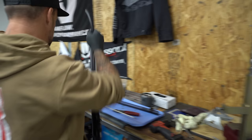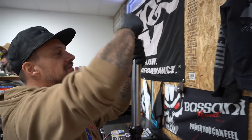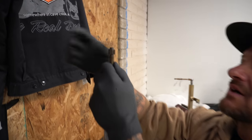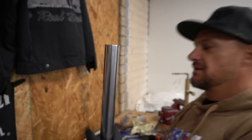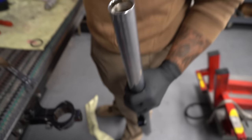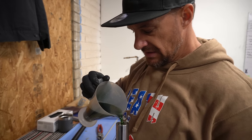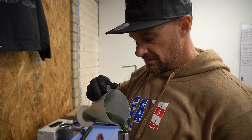Yeah, let's bring this bad boy over here. I'm gonna pull the hose off for a little bit. I'm gonna thread this all the way to the top so I got something to grab with my pliers and not hurt the threads. Drop it back down in there. Everything's capped off. You know, see the tube down there? I'm gonna pour fluid straight on that tube. Kinda helps, you know, preload it with fluid a little bit.